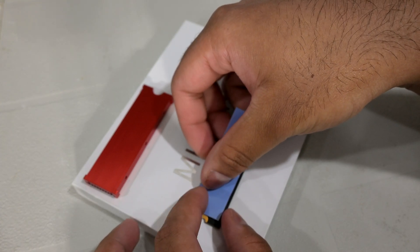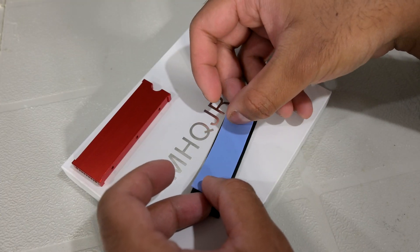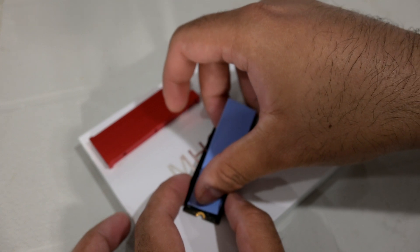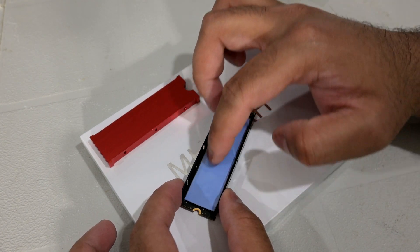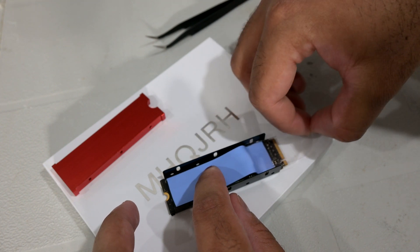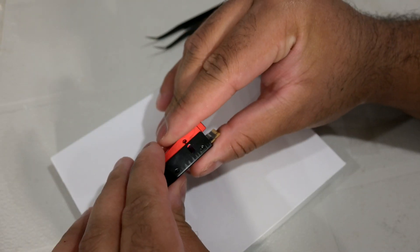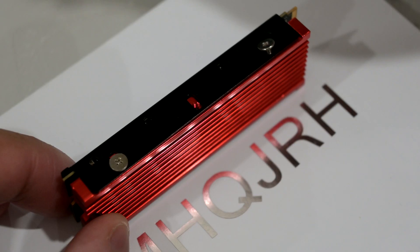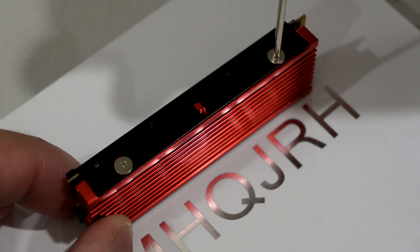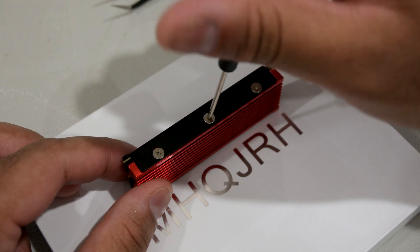After that, I took one of the included thermal pads and installed it on the bottom of the SSD. The pads aren't really sticky, so you can take them off and realign them. Next, I applied the second thermal pad on the top where you have your DRAM, NAND flash, and storage controller. Since the drive was already in the base plate at this point, aligning the thermal pad was much easier. Make sure to remove the plastic protective film off the thermal pad before placing the heatsink on top and snapping it into place. Install the screws on the sides to secure the heatsink, firmly pressing down so it makes good contact — otherwise it'll be too loose and there'll be no thermal transfer.